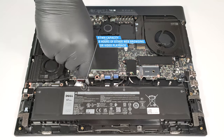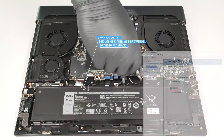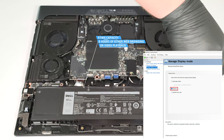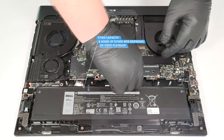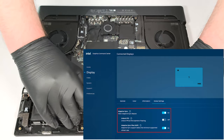To achieve that, you have to select the Quiet preset in the Alienware Command Center app and apply the Optimus mode in the NVIDIA control panel so you can use the iGPU when the power adapter isn't plugged in. Also, you have to select the Balanced preset in the Windows power and battery menu. The Adaptive Sync Plus option is activated in the Intel control panel.